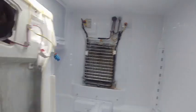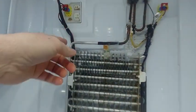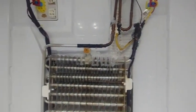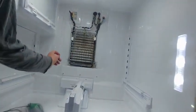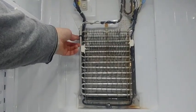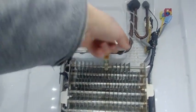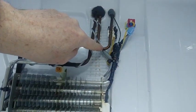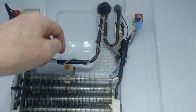If you flip it, you can see it's already starting to ice up — this is our trouble area. This cable, this heater, is going to get wrapped around here in this section. I'll leave a little bit for the thermistor, the temperature sensor. The extra heater has been installed — you can see it starts here and wraps around this piping here. The heat will end here, and I've moved the thermistor up here away from the heat.